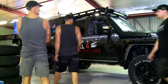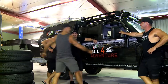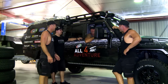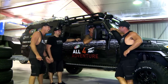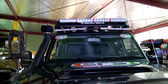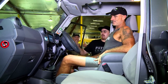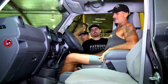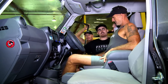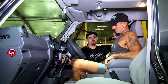The 79, mate — she's a bit of a weapon. This thing is an animal! We've got to show everyone what's in it. Show us what finished this truck off — the finishing touches. So we've got your RedArc gauge over here — that's a battery voltage gauge. It'll do both your main and your auxiliary batteries in the canopy. You've got your X-Ray light switches, all individually switched, so you can run as little or as much light as you want. RedArc brake controller on this side, and Torquette pedal torque right next to it.